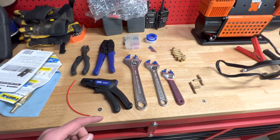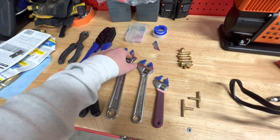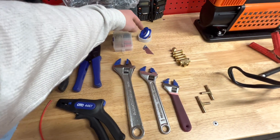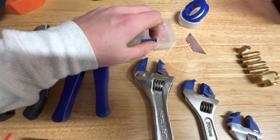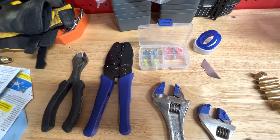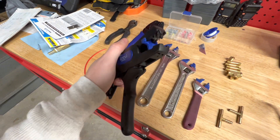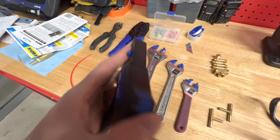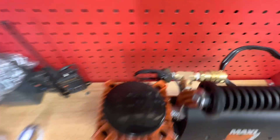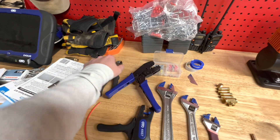Let's check out some of the tools I used in this build. For tightening air fittings I use an assortment of adjustable wrenches with painters tape to protect the surface, a sharp razor blade to cut the hose, some Teflon tape, and heat-shrink solder connectors — you just push the wires together and put a heat gun on it; it heat-shrinks and solders them all at once. I also use a wire stripper and a crimping tool for spade connectors.